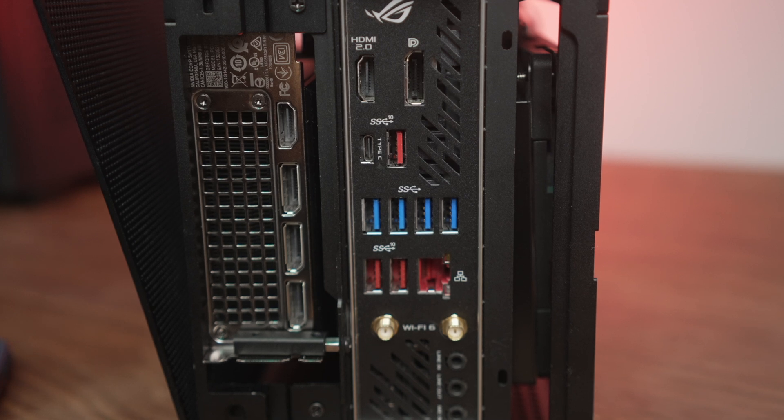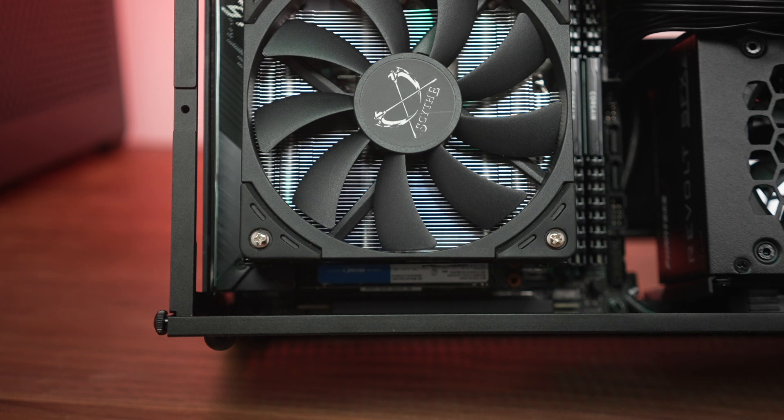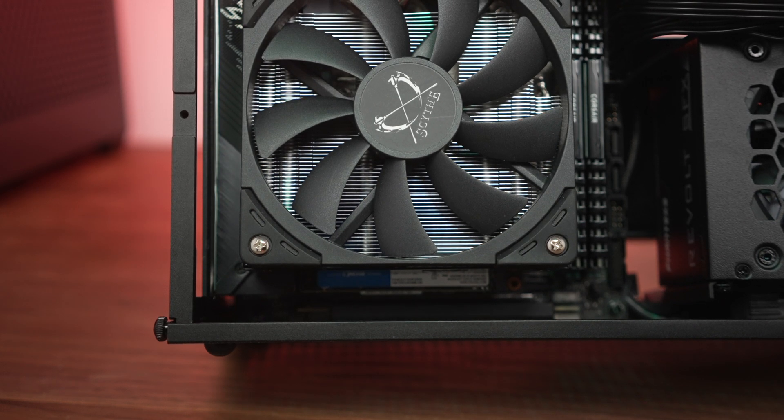And with some of the super overbuilt boards for Alder Lake ITX, that's just not gonna happen. Even with removing the M.2 heat sink, it still pushed up the Big Shuriken 3's heat sink a bit. The results were okay though, and I don't think it adversely affected the cooling, but it's still unstable. I'm not sure — maybe one day the contact gets loose.